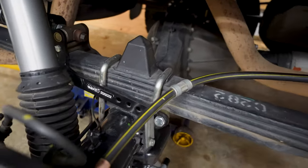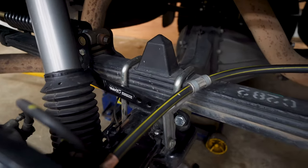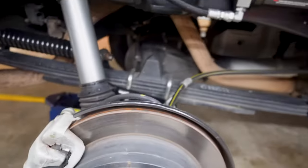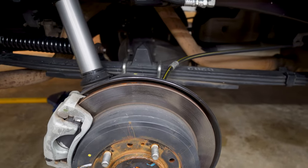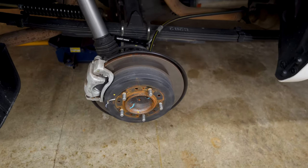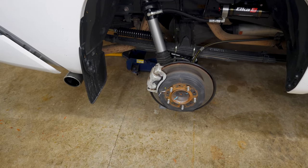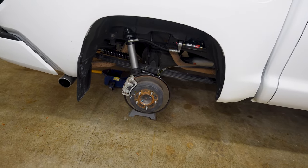Like I said, this isn't an installation video, but you can see how the HD kit looks on the Tundra. It's a very simple install. When you install it, you don't want to lift it up by the axle - I'm just doing this for the video. You have to lift it by the frame so the leaf springs can rest and then you can set your proper spring rate at that level. Overall, the RAS has been a great addition to the truck. It's not a heavy solution, which I'm always trying to keep an eye on payload and weight - something like this maybe weighs 50 pounds and will reduce your payload to some degree.